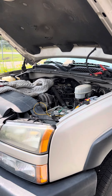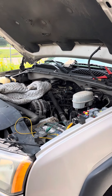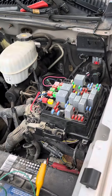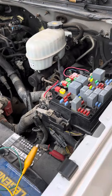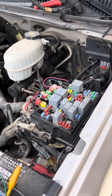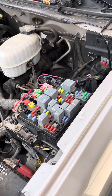The battery was dead, so we charged it up — no difference. Looked online at some videos; most of them tell you stuff that's very obvious, like where the fuses are and how to check them. The top of the fuse box has a diagram showing what each fuse is. A little troubleshooting found we had voltage to the crank fuse when we tried to start it.